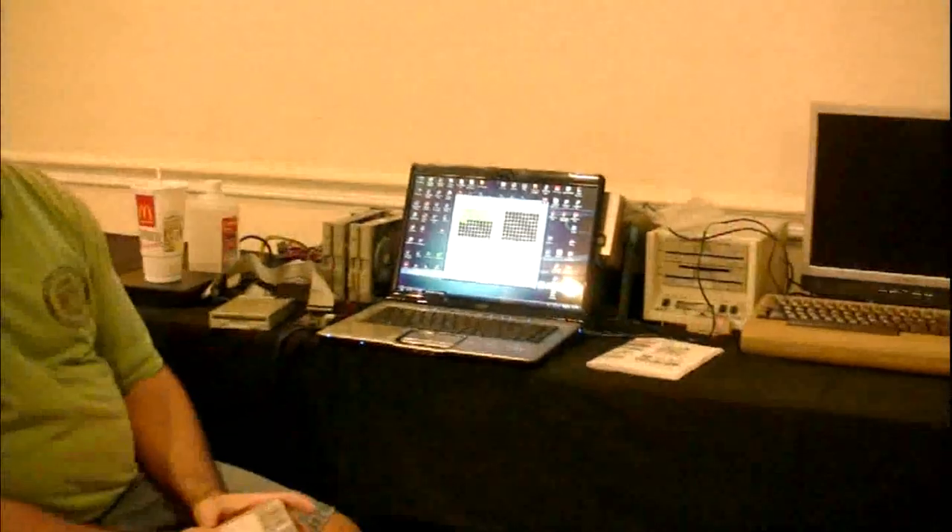The image size for a 1541 disk is about 2 megabytes for a flux image. A G64 file is around 340K. Amiga images vary because there's a lot more data — depending on the flux values, Amiga images will be anywhere from 5 to 7 megabytes for a whole disk. It's not a lot in the grand scheme of things today. How many can you fit on a 32-gig SD card? Your whole collection, obviously.